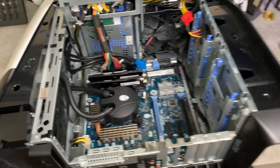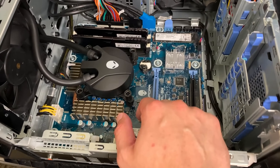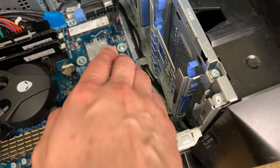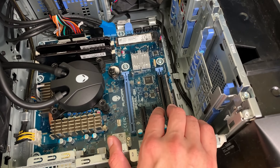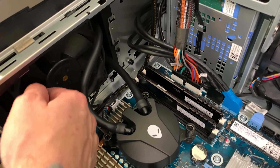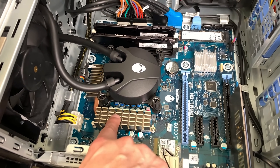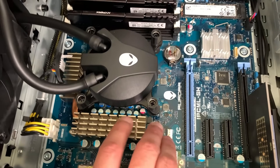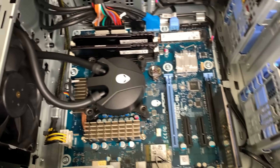This is a great opportunity to look at the guts of an R10 or R11 interior. Here's your motherboard — blue-branded with Aurora and Dell markings. This is the boot drive NVMe SSD. I have a second NVMe SSD on an adapter since there's only one MOBO slot. You have your CPU cooler, which is water cooled — two hoses, a 120mm exhaust fan, and this heat sink here which isn't on some lower-spec models but you can buy from Dell or Amazon for $4 and I strongly recommend installing it.